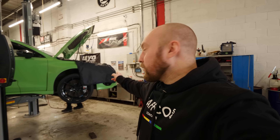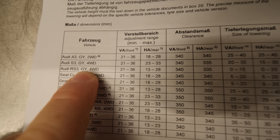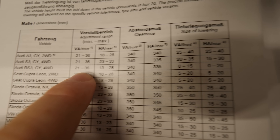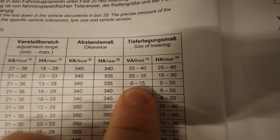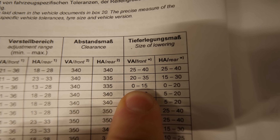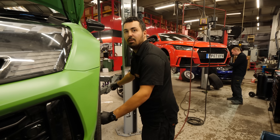What I'd read was that the minimum drop on these was still lower than factory, so I thought that's fine because I don't want it to be massively low anyway. Greg listened to me and did exactly that, but we've just read the instructions and it literally says zero. RS3 — zero to 15mm on the front. So because I said put it at the minimum drop, the minimum drop is zero. The rear is zero to 20, so maybe 10mm. Greg's doing what he wants now.